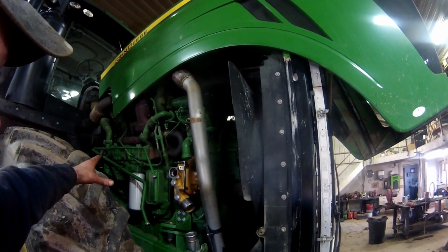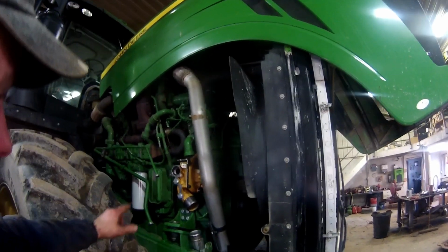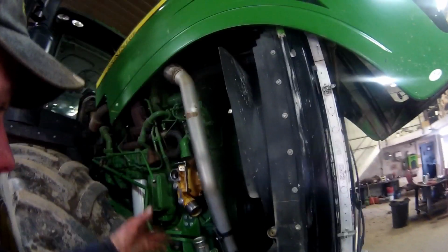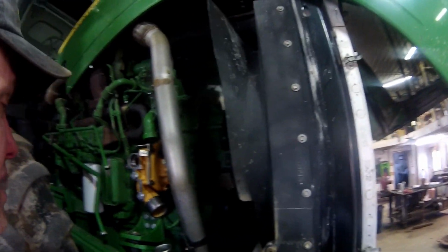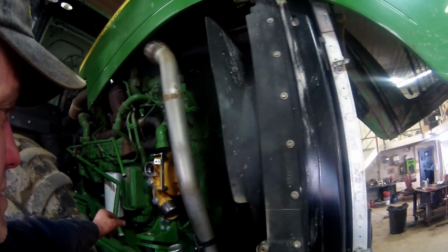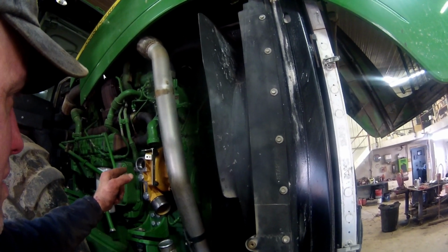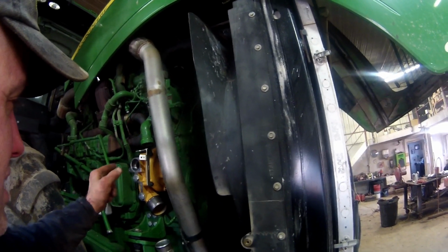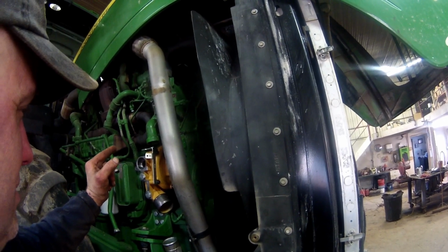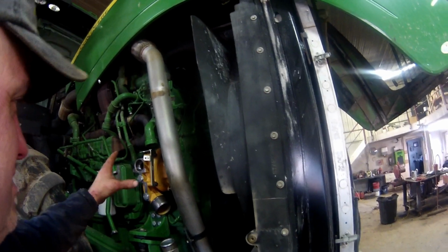This is a 13.5 liter, and on the 12.5 liter they're saying to split them off in there and change them every 4,000 to 5,000 hours. That'll save you an engine. So I don't know how much that costs. I got to look that up. Maybe I'll look that up before the closing of this video, but it's relatively easy.